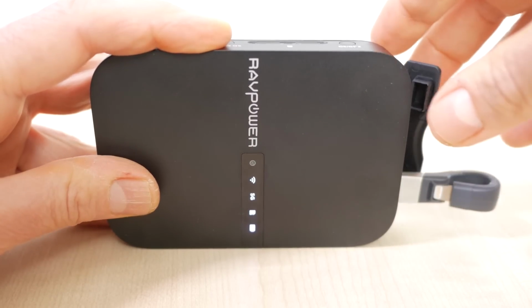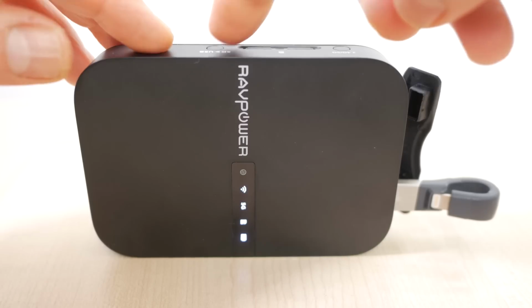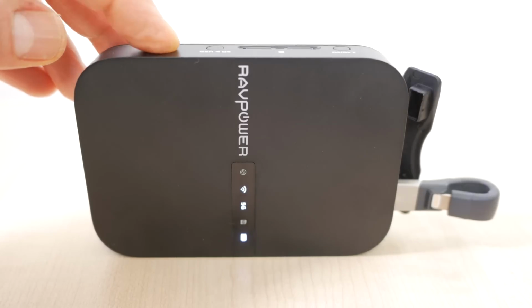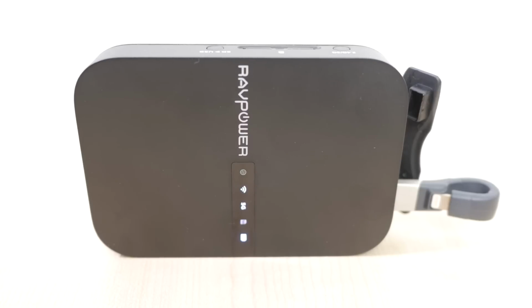With an SD card and a USB drive attached and all lights steady, press and hold this button for about 5 seconds until the SD card indicator starts flashing. The complete contents of the SD card will be copied to the dated folder inside an SD backup folder on the USB drive. It's done when the SD light stops flashing.